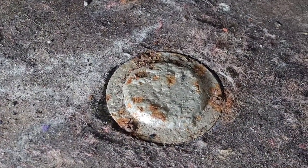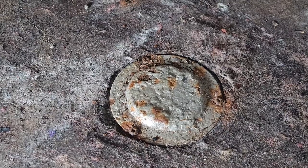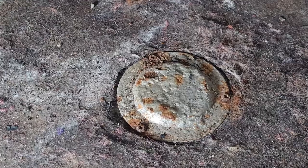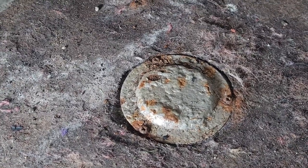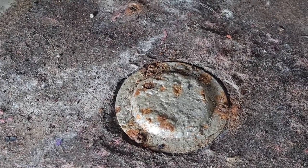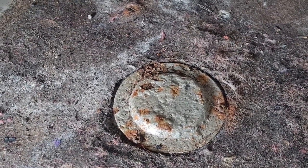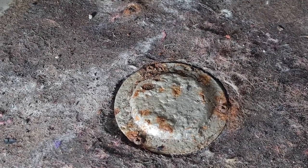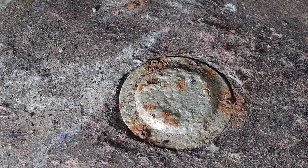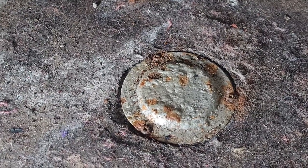This is the next problem I've got - that is the lid inside the driver's footwell for the brake master cylinder. That doesn't look like it's been off since God was a boy. I've tried those screws and they are completely rusted in there, so I'm going to have a bit of grief getting this off. The front drums went back on no problem - there's a light drag on the shoes which is perfect. I may have to resort to drilling those screw heads off and then get them out after with mole grips.